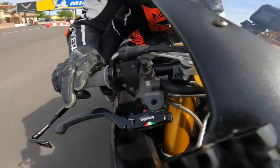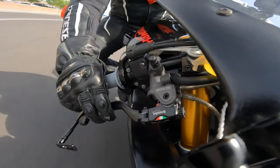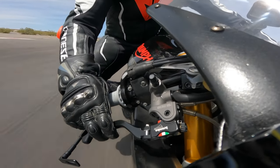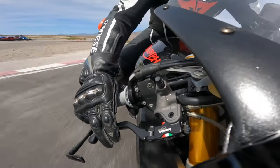But that said, especially when the brakes were cold, whew, it was scary grabbing that lever the first time. That initial bite was really hard, really strong. After the course of a few laps and just working myself up to really using it over the first couple sessions, it started feeling fantastic. Once you got heat in the brakes, the lever pull was super consistent. It didn't fade nearly as much as my OEM master cylinder did over the course of a session.